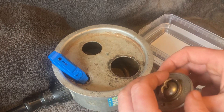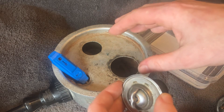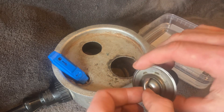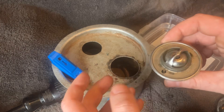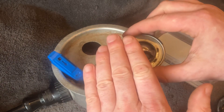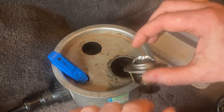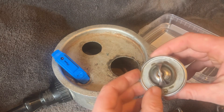I'm going to show you on this video how you can see it operating. I've boiled the kettle and I'm going to put this thermostat into the water and turn the boiling water back on. Hopefully what you'll see is the middle section drop down. If it's seized, it will stay shut and you'd throw it in the bin, but if it's working, you'll see that middle section drop down and allow coolant through.